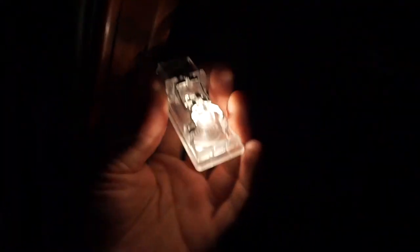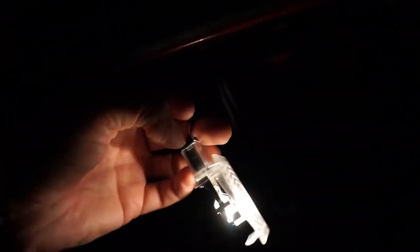It's going to be straightforward. I don't know if you're going to be able to see this back here, but you can see how it looks now — it's kind of just all amber-ish. It's all going to be blue, and then this lights up blue. If you come up here, this guy has like a little edge there which you can use a flathead on. I don't even need to — I can just use my nail and pop it out. In order to change this, you're literally going to pull it out a little further. You should be able to, and it has a harness. Some people change it right here, but I would prefer to disconnect it because this light bulb gets hot. There's a clip right here — you're going to push this down and the light should come straight down.